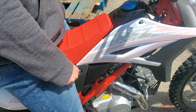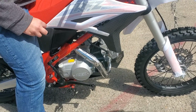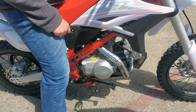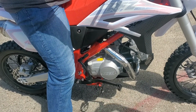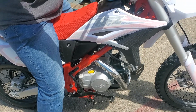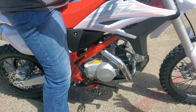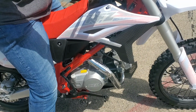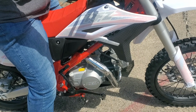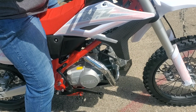So would you recommend the 89 maybe or higher gas? Yeah, I would run 93. Put 93 in it for now, run a little bit, and if you want to run 89 for a few times, just every so often run a tank of 93. We'll probably just do 93 the whole time. Like on my boat, because it holds 50 gallons, I'll start the season off with 93. I'll cheat a little bit during the summer because it's cheaper, run some 89, but then I'll run back and get 93, put some stuff in it just to keep the injectors clean.